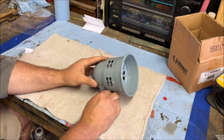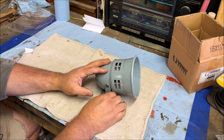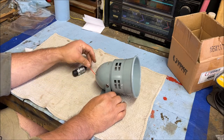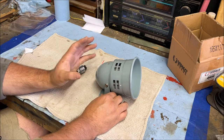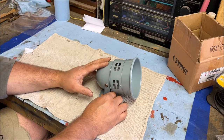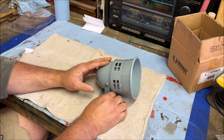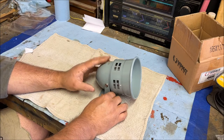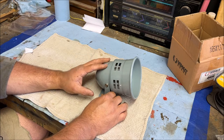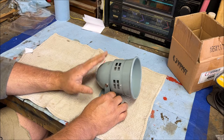I found these inexpensive 12-volt sirens on Amazon — I've put them in several other army trucks and they work great for parades. Being 12-volt operating on a 24-volt system, we're going to tap off one side of the battery to run only 12 volts. People worry about depleting one battery, but this is such a small draw used momentarily in parades that it won't create a meaningful imbalance — unlike a radio playing for hours.